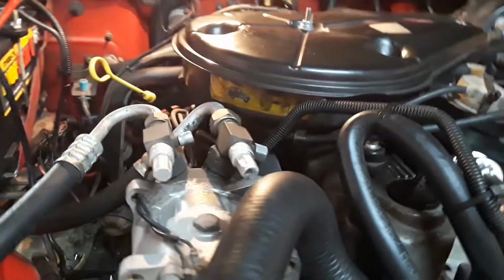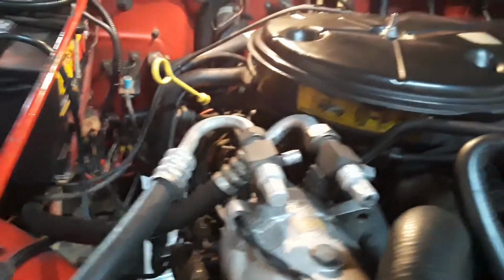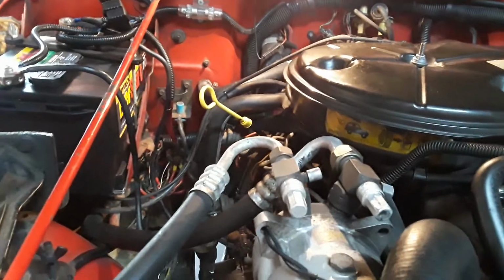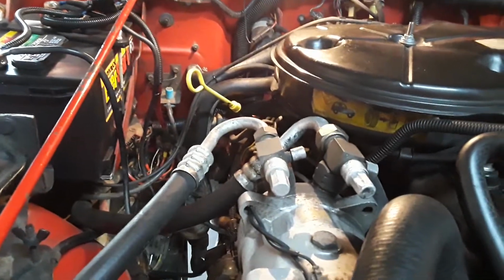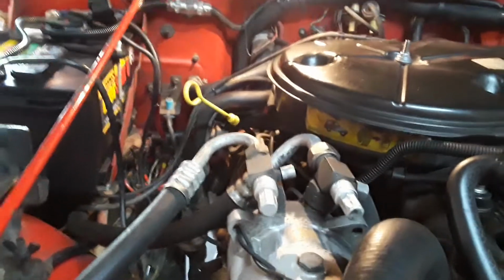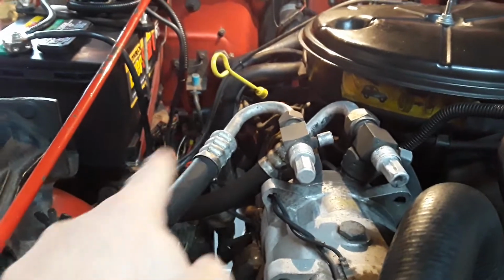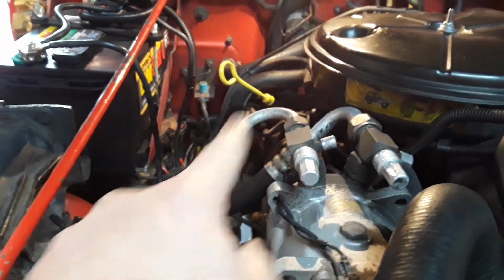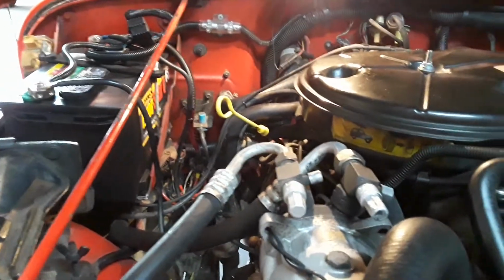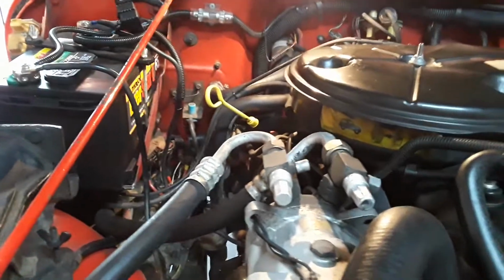So that tells me the ignition system, the module, the distributor, the coil, I don't know, something wasn't getting the proper amount of amperage or voltage it needed, probably both, coming from there. And by simply adding those 5- or 6-inch leads in there and crimping and soldering them on, it has totally fixed it. So that is a choke point for your ignition system.